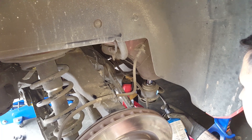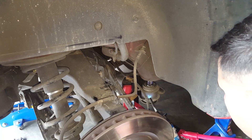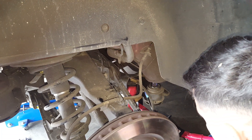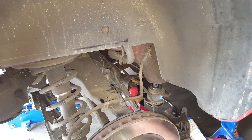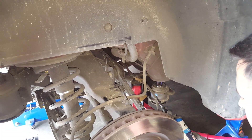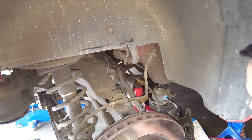If you start melting the plastic, it'll usually start oozing out the top. Give it a little pump — not too much yet. You really just want to make sure that you evenly heat the surface of the hat, and be patient. This is the front one, so it comes out a lot easier than the rear one. I just did the left side, and the rear ones are kind of a real pain. You've got some smoke, so you're definitely heating things up on the inside.